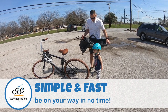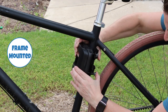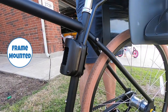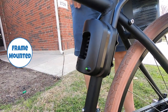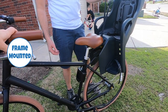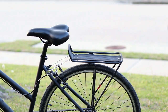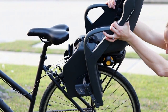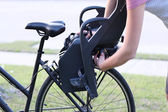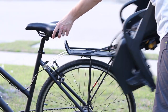And our last reason, number five, taking the seat on and off is simple and fast. For the frame mounted version, once the mounting block is installed on the bike, it's incredibly easy to mount and unmount the seat. You simply insert the mounting rails into the holes in the block until you hear an audible click. We also love that you can see that the rails are locked because two green tabs pop out. To remove the bike seat, you push the front face of the mounting block and lift the seat's mounting rails up and out. For the rack mounted version, once you have a rack installed, you simply place the seat on the rack and turn the side knob until the mounting tabs tighten around the sides of the rack and lock into place. To remove it, you turn the knob counterclockwise. This process isn't quite as fast as the frame mounted style, but it's still quick nonetheless.